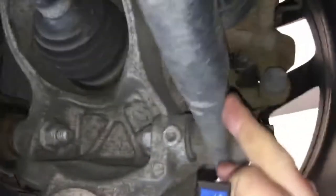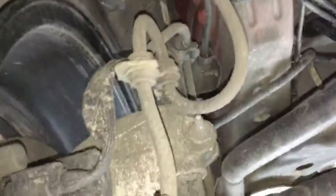Checking all the inside of the wheel — all the CV boots are fine. The brake pipe flexes and the back of the discs all look in good shape. Suspension wise, the bushes all look fine. Passenger side the same again — all the CVs fine, drop links, everything's good. All the brake pipes are all clipped in nicely, no concerns, no signs of anything that's caught the underside of the vehicle. All the shields look in good shape. Rear suspension wise, all the mounting points look great, no concerns. Brake flexes are all fine. Same on the passenger side as well, and all the mounting points there.